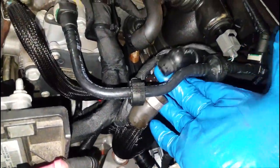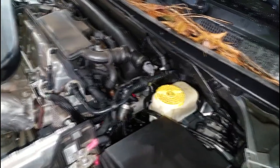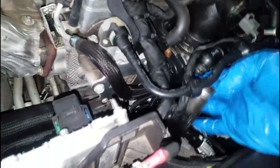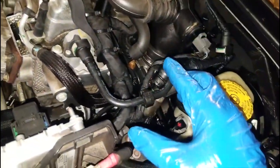That's where the leak is coming from. This hose is broken right at that nipple — it's cheap plastic. One thing I do not like about Chrysler is they've always had problems with their connections: heater hoses, things like that.